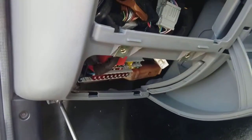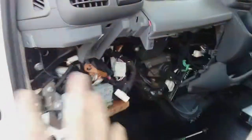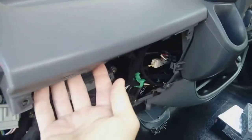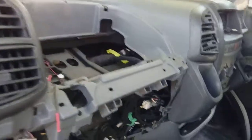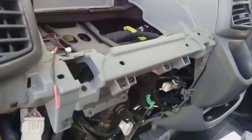Your last remaining TX30 down here will actually make the whole thing drop, so I'm just going to have to hang on to it to pull it all forward. With this bottom one removed, try and secure the weight with one hand while you remove this TX30 — whichever you're going to use here. You'll have already removed the side TX25. So that's your last one — just support it now, because the whole lot is now loose. We now have fantastic access to get all the cabling running across, and access to two TX25s to remove this top pocket. Go ahead, take those out, lift your pocket up. You can now quite easily run your DAB antenna cable all the way across and up to the screen pillar, which is where we're going with it.